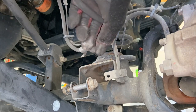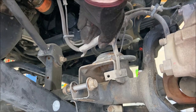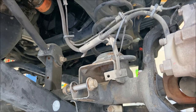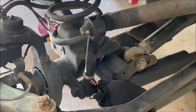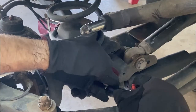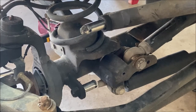Since I already have a lift, I made my own brake line extension with a T-shaped piece of steel to get the bracket a couple inches above the normal mount. If you have the stock setup, you'll definitely want to remove this bolt — probably a 10 millimeter — to free up the brake line so nothing gets hung up when you lower the axle. Next remove the sway bar links: mine are JKS quick disconnects, so just pull two pins. Stock ones likely use an 18 millimeter, and the ball joint inside might spin so you may need an allen key.